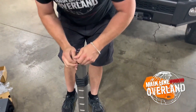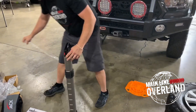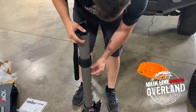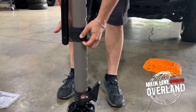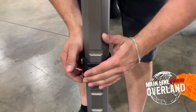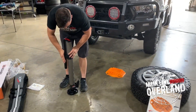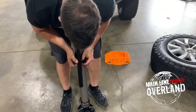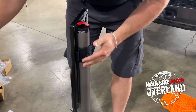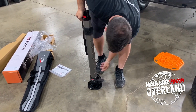Got these nice little covered pieces. Right at the back we've got an aluminum housing with these little detents. We have a jack handle holder that looks like it doubles as body protection — you push this piece against the area that you're jacking up, and that gives you some rubberized bump stop protection and standoff. This piece sits into here, and these little teeth, if you bring it up high enough, will hold your jack handle in to retain it when you put it in the bag. Then it comes down to create the jack base piece.